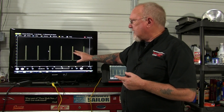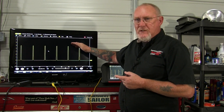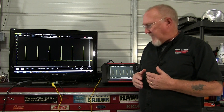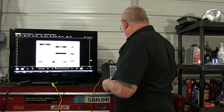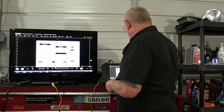There are really three elements we want to talk about today: trigger level, trigger slope, and trigger position. Let's start with trigger level. This pattern is running from 0 to 5 volts. If I want to stabilize that with a voltage level for my trigger, I need something in that range — not at 0, not at 5, but somewhere in between. How about we use 4 volts as a starting point. So let me open up the trigger window for this scope — select trigger, trace 1 — and we're going to use the voltage scale here to set up a 4 volt trigger point.